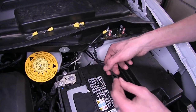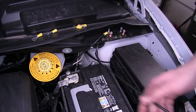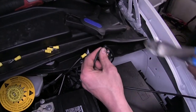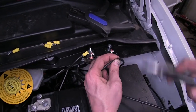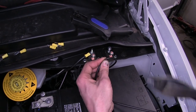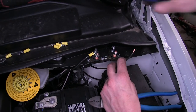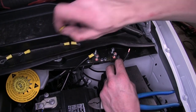Here's our black wire. We'll just pull the slack out now, making sure we leave enough inside the vehicle. We'll measure off how much wire we're going to need to connect to the silver side of our 30-amp breaker right here. We'll strip off some of the insulation and attach a small ring terminal to it.